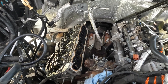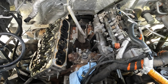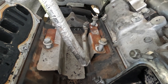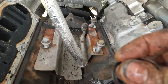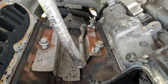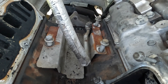To take the turbo off, the lower three bolts are 15 millimeters. To get to that front one, you're going to have to use a swivel to get down around the inlet portion of the turbo. Here are some of the gaskets on the banjo fittings. You're going to have to use a swivel and an extension to get down into that bolt right here because it is kind of under the intake portion of the turbo, the cold side.